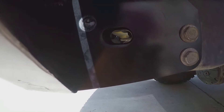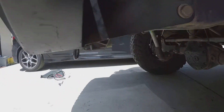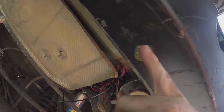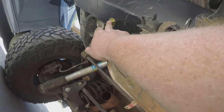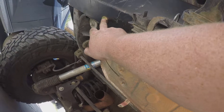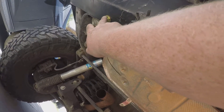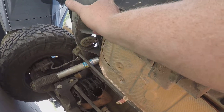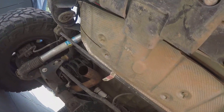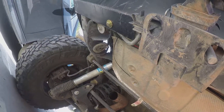I have not done it because I've got this bumper used and it did not come with the hardware. Do one on each side. Then, depending on your year, you may have to drill out this hole and that hole — top and bottom. Mine, I've only had to drill out the bottom on this one. Then you'd get the four and a quarter inch long half inch 13 bolts, washers on both sides with nylocks. Put them in there, tighten it down, put the factory bolts back in — and that's really it.